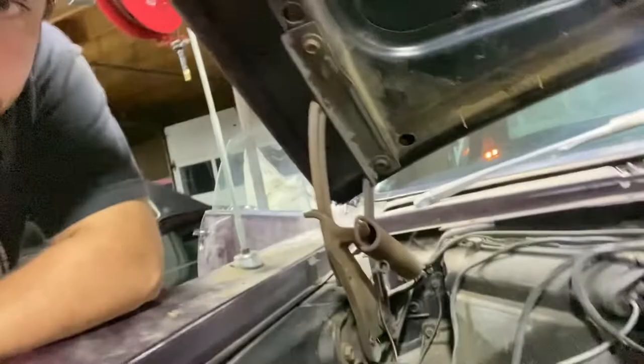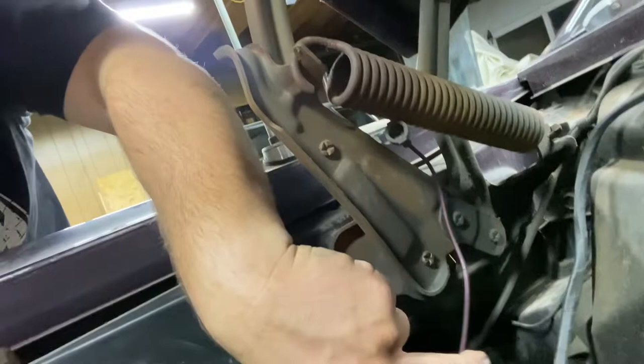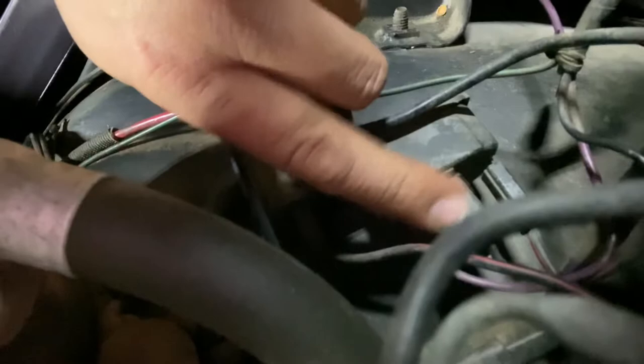All right, back again. So, digging into this, I look down here and see this beautiful purple wire, which is what we were looking for, right? I thought that went to the antenna. It still might, because it doesn't go to the starter, because the starter has wires on it, and it definitely doesn't have spade terminals on it. So then you dig down here further, and we've got a black and red wire. Even you guys in the video can see that, kind of. We've got a black and orange wire. I can't find a black and red wire on this schematic at all.